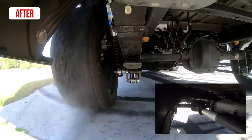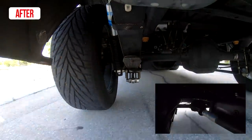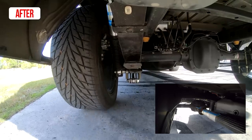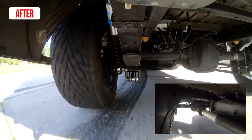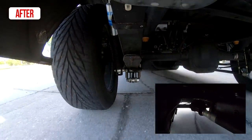With the installation of the Caltracks traction bars, what we're doing is basically keeping the rear end in a relatively fixed position as opposed to the front mounting point and this bottom mounting point here, which keeps the leaf spring from getting shorter and longer as it bends and gets that S-shape from the suspension loading and unloading. This basically just keeps everything a bit more rigidly mounted and keeps it from flexing.